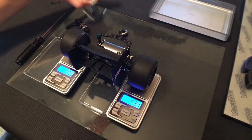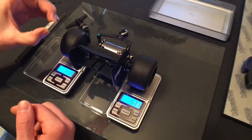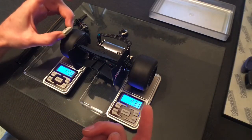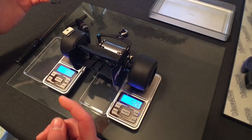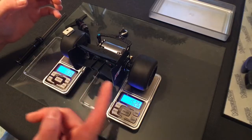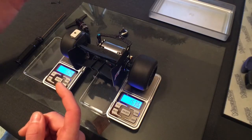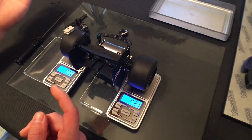You can try using weights. Just know that everything you do is, because it's a solid axle, going to affect left and right at the same time. And depending on how far out you put the weights may depend on exactly how much weight is added or taken off.